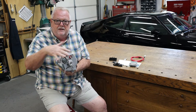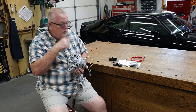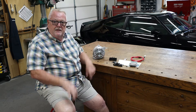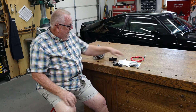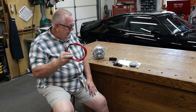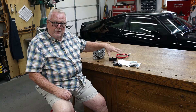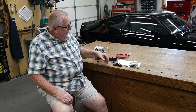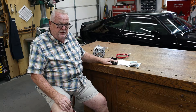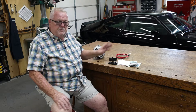The 3G has its own plug, so there's a pigtail they send with this kit so you can adapt everything, and there are instructions on how to wire it. The serpentine pulley is not going to work, so we'll be transferring the pulley off the 1G alternator onto this one. We'll be wiring up with four-gauge wire — I bought a pre-made wire with two lugs already on it from Amazon. We'll also be adding a mega fuse holder and a 200-amp mega fuse, just to make sure that if there's ever any catastrophic failure, it'll blow the fuse and not damage anything else.